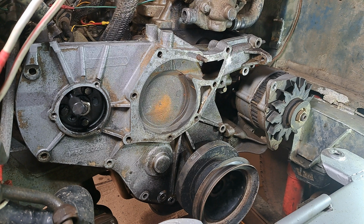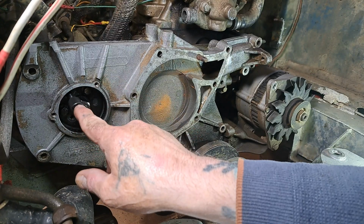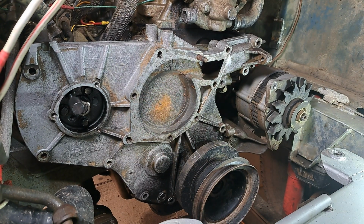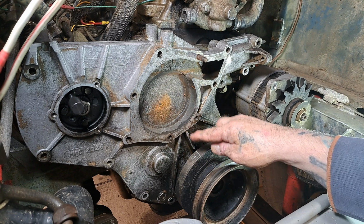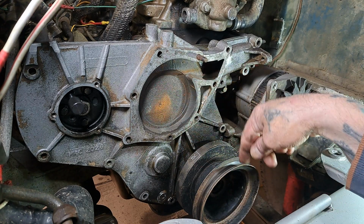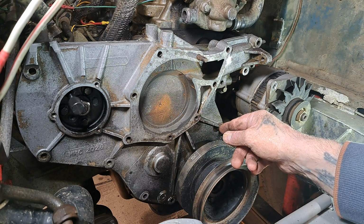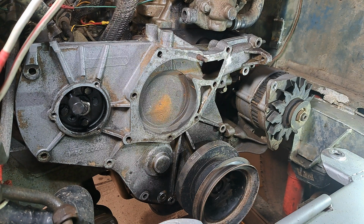A little bit disconcerting at the moment, because in here it's looking very oily. I've put the pin in for the fuel injector pump, and I've got top dead centre lined up with this bit of the casing. So with that there and that there, the Woodruff key will be pointing upwards towards the top dead centre mark, the other side of the cover. As you can see, I've taken everything out so we can get to it. All the radiator and everything's out.